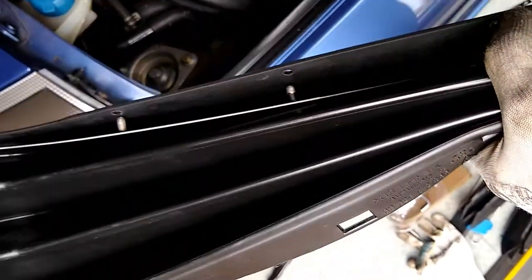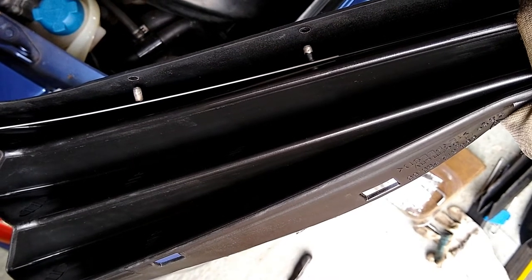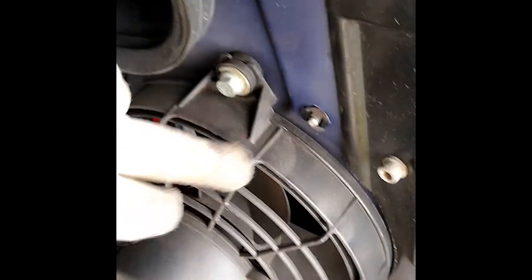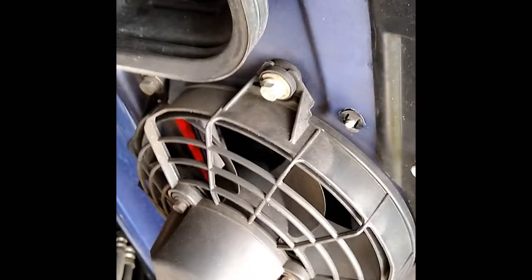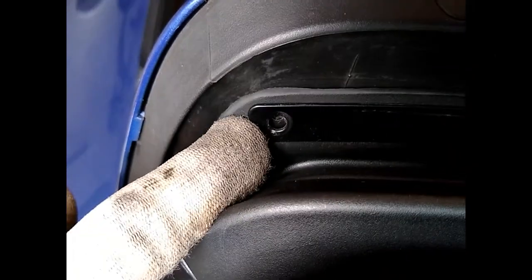This is the metal bar that sits in there with the pins that will push through into the boot lid. The bottom edge is now in place — I've pushed these pins through and put the new clips on top. To replace the clip on the one behind the fan I am going to need to remove it; those look like 13mm bolts, three of them, so I'm just going to undo those to get to that final one. Once that's done, it's a case of putting the metal bar on the top edge, which will then clip in. Just put the top section in — it slides to the left to clip into place — and then make sure the hole in the rubber lines up with the hole in the metal.